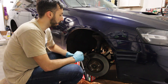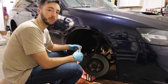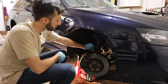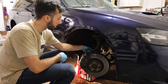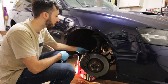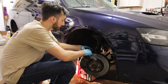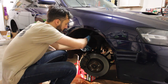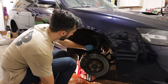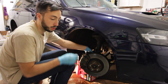We are on the passenger side of the car. We were able to get the rotor and caliper off on the other side but unfortunately didn't film it, so we'll film this side for the walkthrough. Caliper bolts are both broken loose. I'm going to loosen up the brake line so that when the caliper comes loose, I can set the caliper down and leave the brake line attached until we pull all of those off and drain the old fluid since we're replacing the entire system. We can break this loose and disconnect the brake line from where it hooks up to the strut — that's just a 12mm bolt.